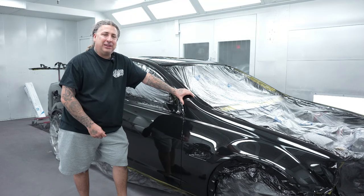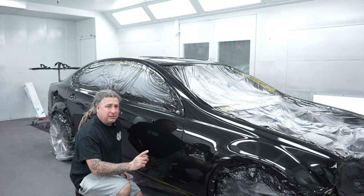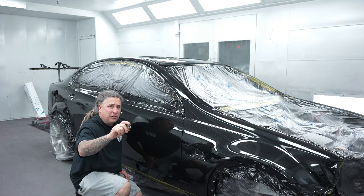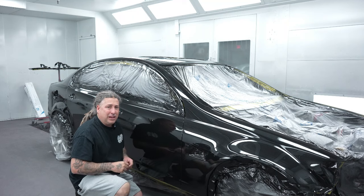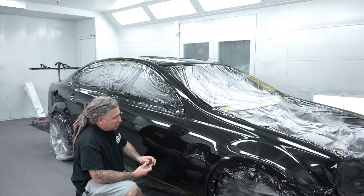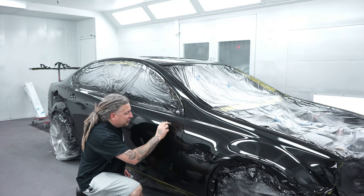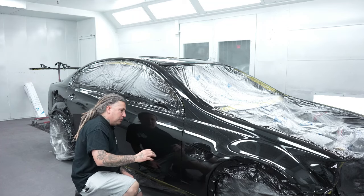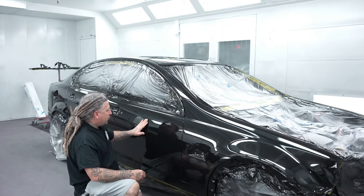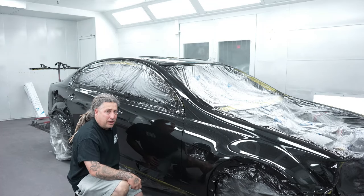The first thing I do is go in the booth while it's taped up, because this is the best place to see any dirt. A lot of you guys said the finish was perfect — it is a nice finish, but it does have some dirt in it. We're going to knock down any dirt nibs. You'll want to use a hard block. I'll leave everything I'm using in the description. First, identify the dirt — here's a decent-size nib. Mark your dirt while you're in the booth; this is the best place to see and feel it. You can also run your hand around it to feel for dirt. We've got another small one here, so we're going to go around quick, mark the nibs, then get out of the booth.